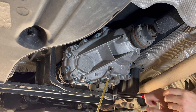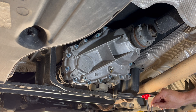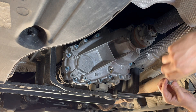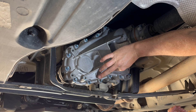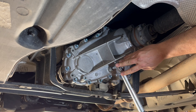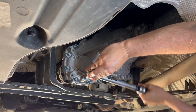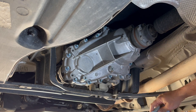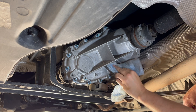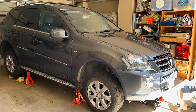You can see that's full now, so we'll take the pump out. Move the fluid out of the way, then pop the fill plug in — you can see it's just dripping, which is fine, indicating it's full. Torque the fill plug to 25 Newton meters as well, then double-check the drain plug. Give everything a wipe off. Really important not to over-tighten these drain and fill plugs — it's an aluminium housing and if we break that we're in serious trouble as a DIYer at home. The final step is to take the vehicle off the jack stands.